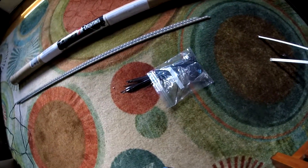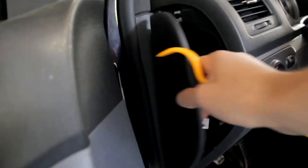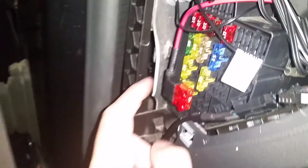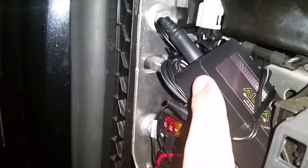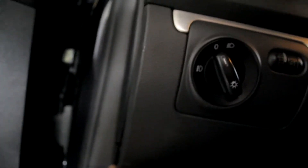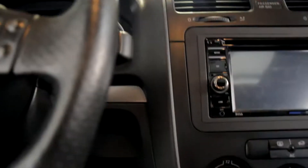It also comes with mounting hardware and plenty of zip ties. The first step is to go to the car and tap the fuse. Behind this panel we have a fuse tap on the fan that's grounded behind this control box, and the control box is in some extra space. There's wires coming from inside there, coming down and into the footwell of the car. The reason why I tap the fan fuse is that the lights should turn on when I turn the key on.